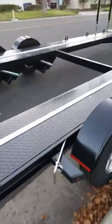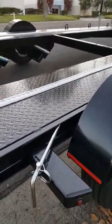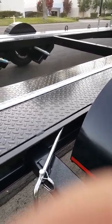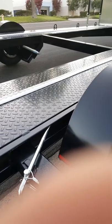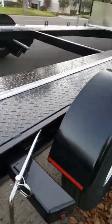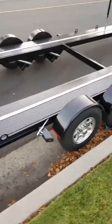Around here we've got the suspension stops. In practical use they shouldn't really ever be needed, but they're more of a peace-of-mind thing — they prevent the trailer from lowering fully. If you were to get a leak in the air system — which is the primary question we get — it's unlikely because we use all DOT fittings. They're very reliable, designed for trucks doing millions of miles, and they're all plumbed individually so you'd still have three airbags functioning even if you ever did have a leak.